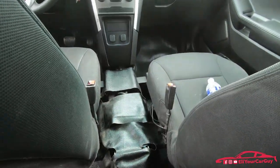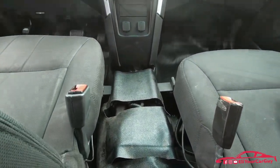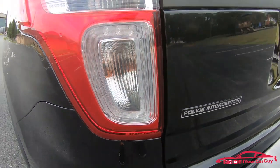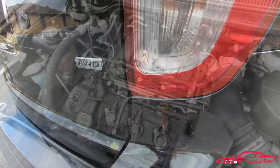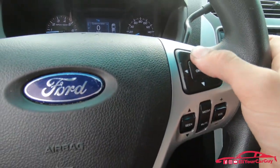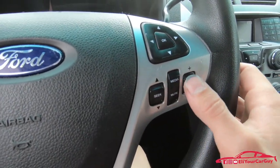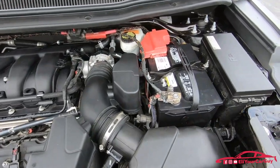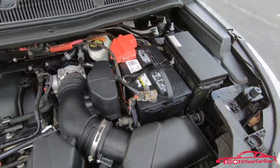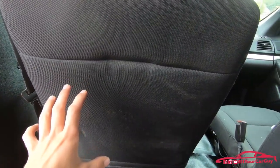...you're going to have a 9-inch space between the driver's seat and passenger seat for aftermarket police-installed consoles, two 12-volt power outlets up front, 75 mph rear crash testing, standard all-wheel drive, a heavy-duty 220-amp alternator, AM/FM stereo single CD player with MP3 capability, clock, and six speakers. The battery is a heavy-duty 78-amp, 750 cold cranking amp battery from the factory.